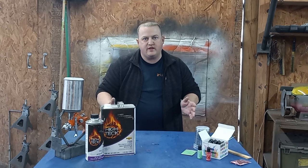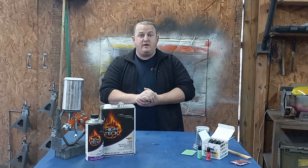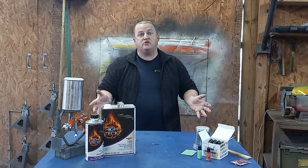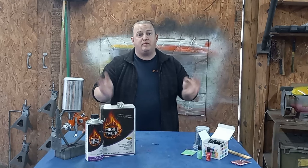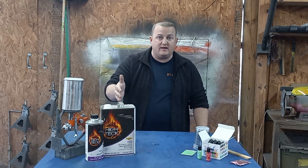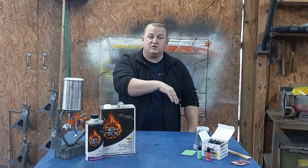Now, a lot of people have heard of Kandy paint jobs, and a lot of people have tried to do it various different ways, but two words you never hear together are Kandy and Rustoleum. So today I'm going to be attempting what I've researched and realized is probably the world's first Rustoleum Kandy paint job. If you understand how Kandy works, it's transparent, and you usually shoot a Kandy base over a metallic base, and it works like a tri-coat where you do it in three stages with the clear on top.